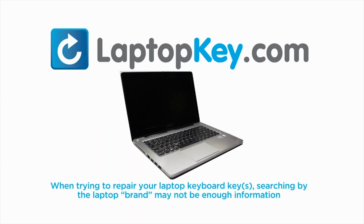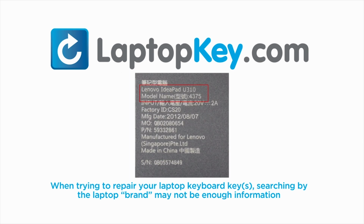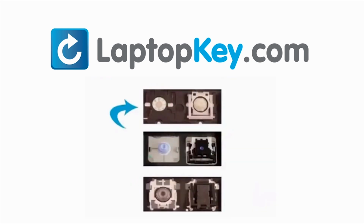Notice, when trying to repair your laptop keyboard keys, searching by the laptop brand and model may not always be enough information. Many times laptop manufacturers produce keyboards that look the same on the outside, however have differences underneath the keys. The differences include the hinges, retainer clips, and cup color.